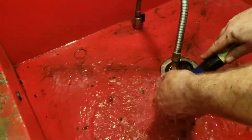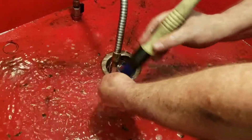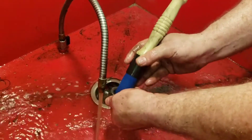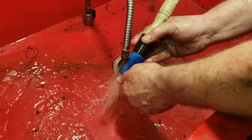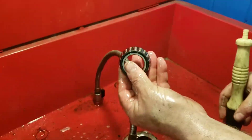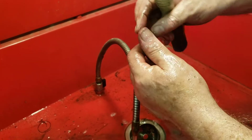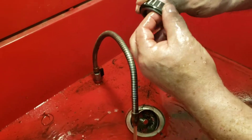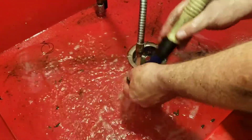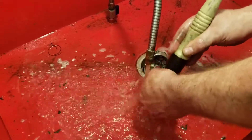You can see it's getting cleaner. I like to try to get the bristles of the brush in the rollers. As you can see this bearing has a few parts: the inner race, the cone rollers, and the cage that holds the rollers in place. You want to make sure the cage isn't smashed, broken, or cracked — and it all looks good. This trailer is not exactly brand new — I think it's an '04, maybe even older. This may be the first time the bearings have ever been serviced.